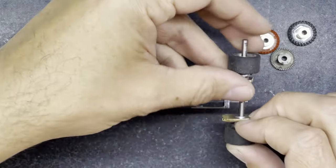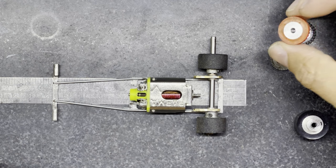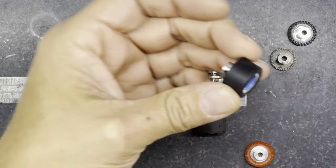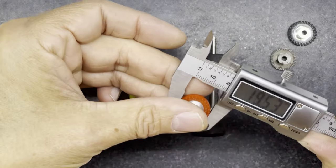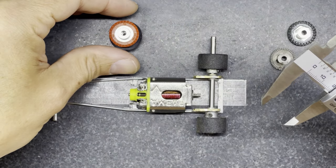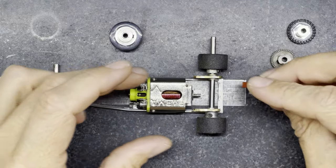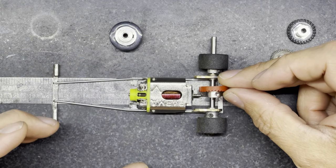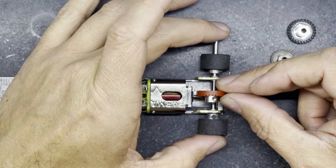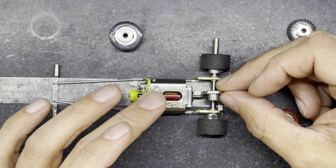The next thing is the exact position the axle is going to sit relative to the motor. This is definitely the biggest gear I could ever get away with on this car, bearing in mind the size of those finished tires - this gear is 17.6mm, so that's the biggest I'd get away with. These two gears are a slightly smaller diameter, so when the gear sits on the axle I need to make sure the axle is in the right place for the gear to mesh on the pinion, and also right for the smallest possible gear.